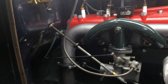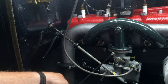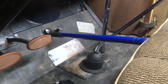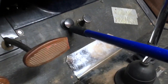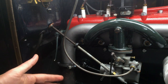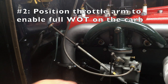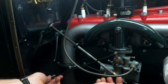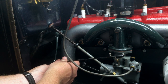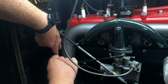The next thing to check is wide open throttle. Disconnect the carburetor rod at the throttle arm and notice how the throttle arm is down around the seven o'clock position. Now find a way to hold the accelerator pedal to the floor — in my coupe, the handle of a hydraulic floor jack is just about the right size. Notice that the throttle arm has now pivoted; with the accelerator pedal on the floor, this is the maximum travel for the throttle arm. You need to make sure that at this point the arm can open the throttle all the way. Reattach the carburetor rod and check the position of the carb throttle lever — it's got to get all the way over to that stop. Mine goes a little too far, but that's okay; you can have a little springiness in the system.